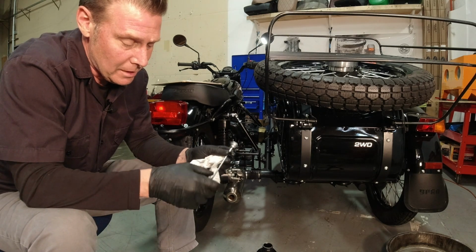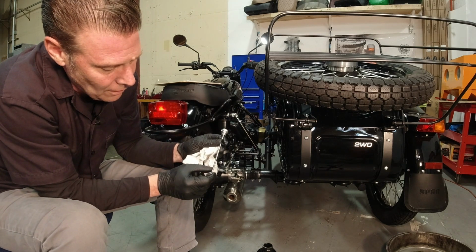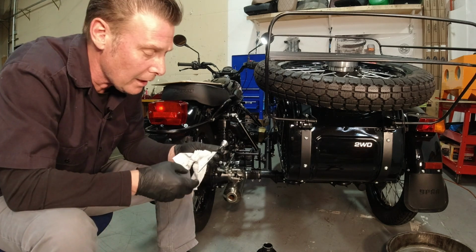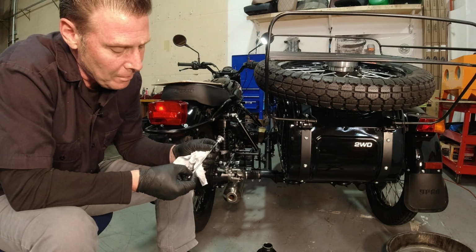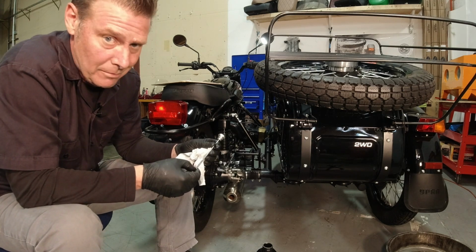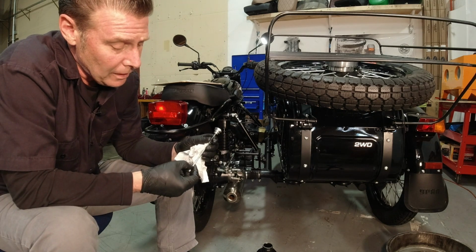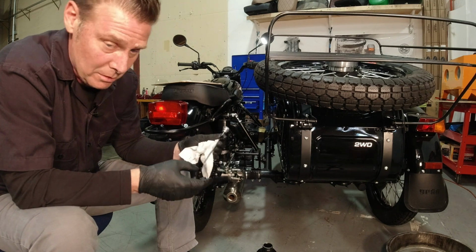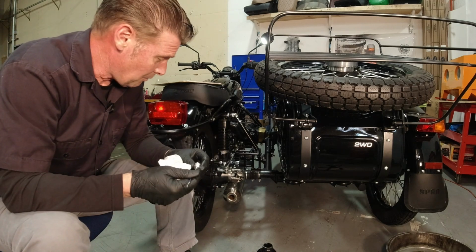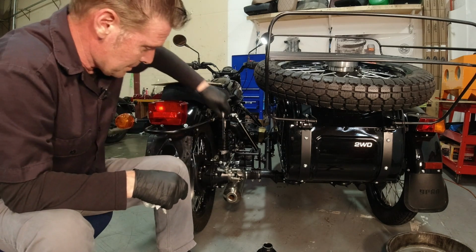Visually, when you dip it and check it, 135 milliliters would have probably been just above the line and you would have thought okay. Or I was real close to pouring in 115 milliliters in there with the bottle just by luck. And that's right below the line. So I'm going to leave it like that until I warm up the bike and ride around the parking lot. Then I'll check all the fluids again.